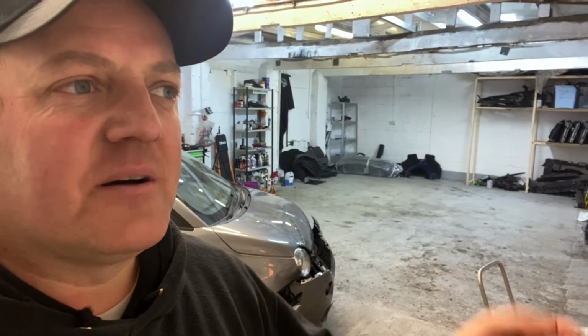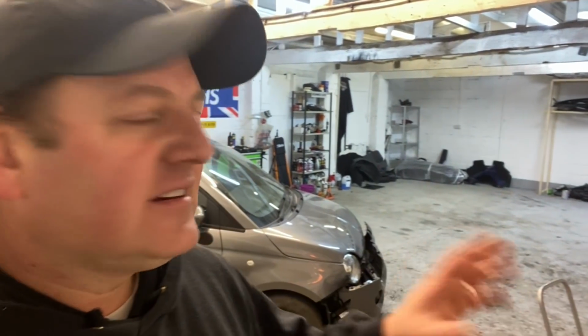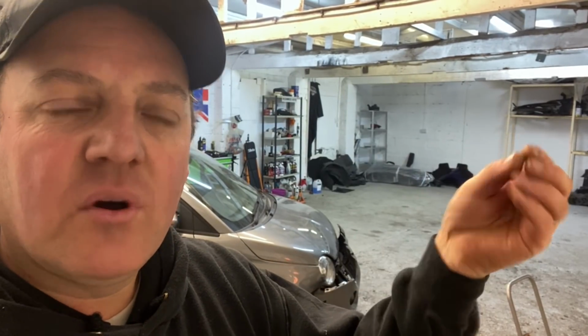I'm gonna rip down the brakes. We're gonna pull them apart, checking them, cleaning them, changing all the pads. Got Brembo brake pads all around to change, new ones. Clean the discs, because the discs are alright, don't need changing. And get that OBD port sorted. I've got a longer one, and then I'm going to be soldering the wires together and then heat shrinking around it as well to double it, and tape it with the black tape that they use from the factory. So yeah, we'll be doing that. Let's just jump into it, guys.